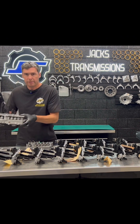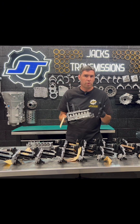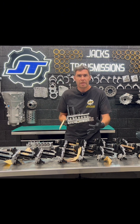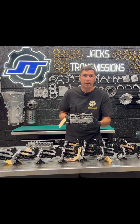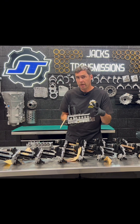Once the unit is complete and assembled, we install it in our short-term tester rally car with an updated version of our tune that will tax the line pressure valve in this valve body. It runs through a series of tests to make sure that the pressure regulation is consistent and accurately on target where it's supposed to be.